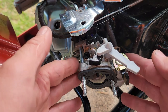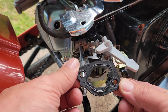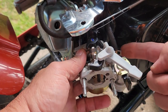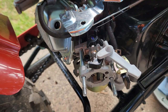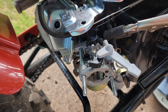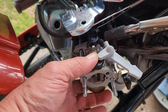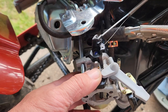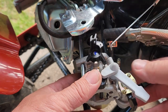We're going to take this gasket off — remember how that goes on. Now we've got a fuel line here that we want to pinch off, so I've got to go get a fuel line clamp, and then we've got the linkage here to take off. Reach down here and pinch the clamp, slowly ease that off — there we go. Now we can pull this little spring out and it came right off.